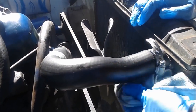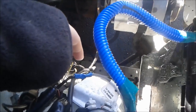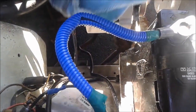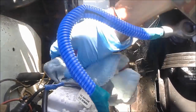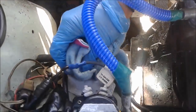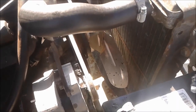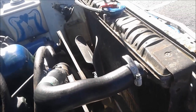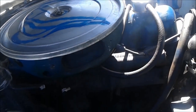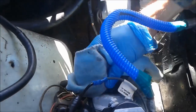But take a little bit of carburetor cleaner. Carburetor cleaner is actually really good stuff. If you've got a greasy part or anything with a little bit of corrosion, you can actually knock a lot of that off with carburetor cleaner. As a matter of fact, there have even been times in my past that I have used carburetor cleaner to clean heavily greased parts. I've done it here too with Project Spirit. Carburetor cleaner is amazing stuff because with regular engine degreaser, you have to wash it off, otherwise it just messes things up. Well, what happens with carburetor cleaner is it evaporates.